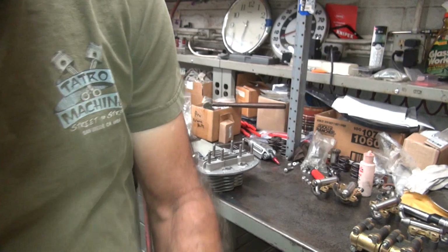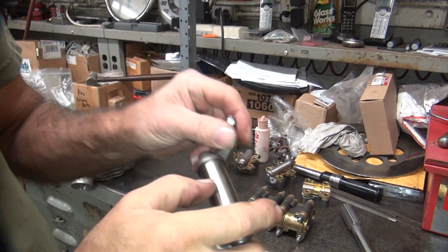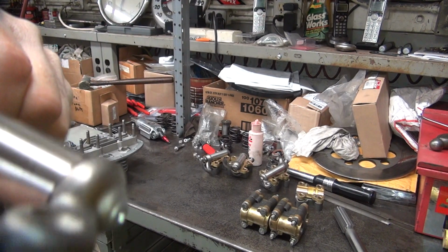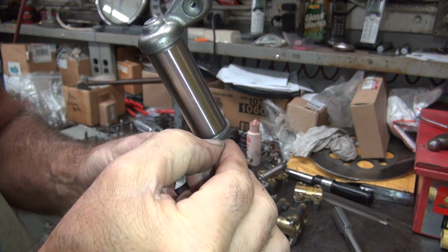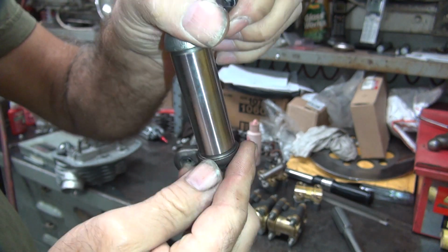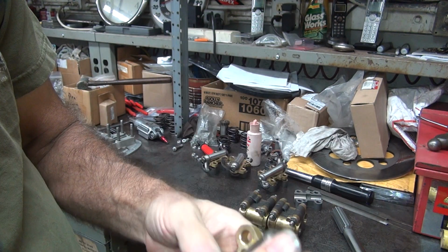I tried filing on that one arm because the arms are a little smoother. The thing is how much of these edges over here are sticking up, making noise. Those sharp edges over here will dig into the side of the block, which should be right here, and it will make noise.